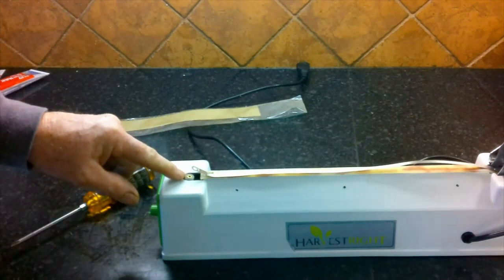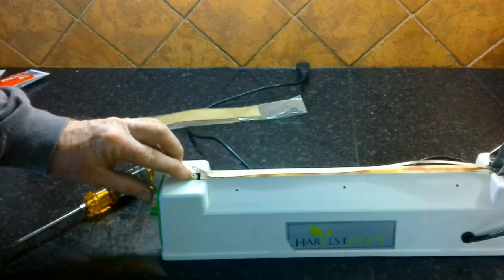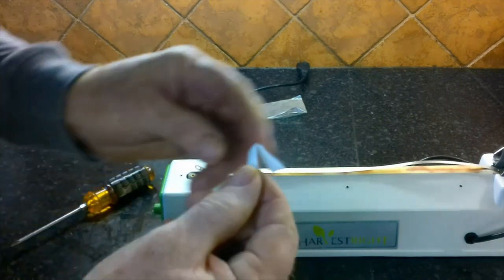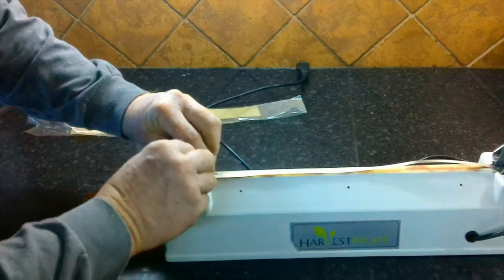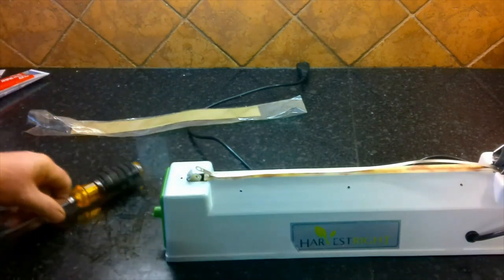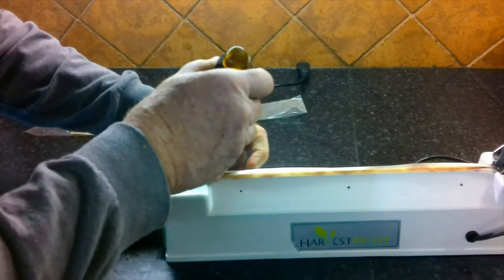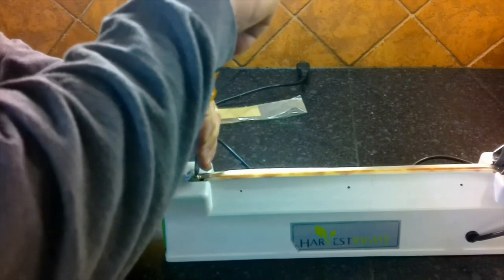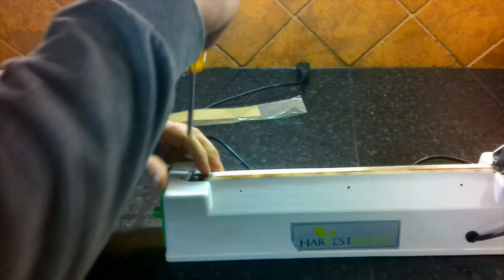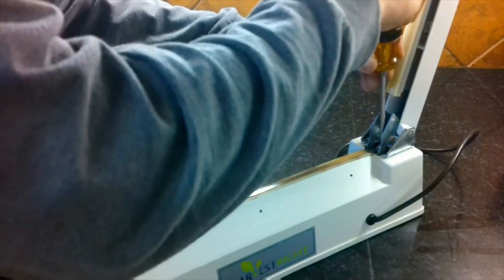Putting the front side in can be a little difficult because the electrical contact points are spring-loaded. So I took a little piece of paper, folded it up, and bent it to make a paper wedge. We push the contact point forward, put the paper wedge behind it to hold it in place while we put the screw in. Snug that up, take out the paper wedge, then come back and tighten the rear screw. There we go.